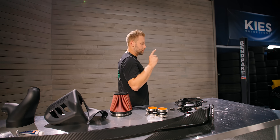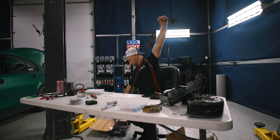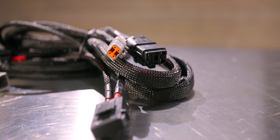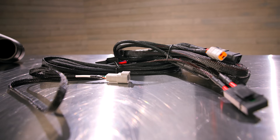Over here, this is more of a maintenance odds and ends thing. As many of you know, I have a max ECU that runs my port injection. As I have it set up right now, my port injection for my secondary pump runs all the time — so I get in the car and it just starts up, even if I am totally idling. That's not really the best thing because you can burn the pump up from just having it run constantly. So Precision Race Work sent out a new wiring harness that's going to tap into the max ECU so that I can have it come on at a certain RPM and boost level, so I'm not prematurely burning out the pump. We've got a lot going on, so let's throw the car up in the air — and there might be a surprise under the car as well.